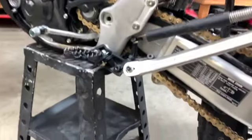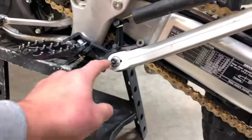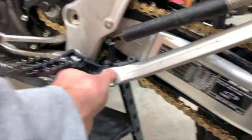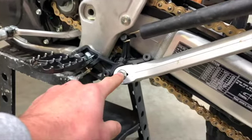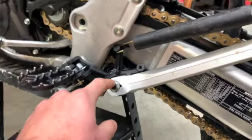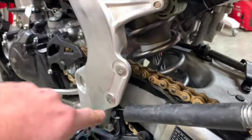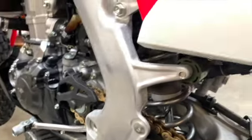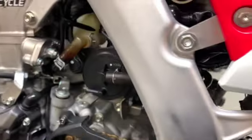I did this real quick while my phone was charging — eliminated the kickstand sensor. The mechanism is here. I took the two bolts of the guard off. I actually used one of the short bolts and just put it in here so it looks cleaner. It runs up to a bracket here. I ground the two tabs off on the bracket so it's just a little bit cleaner. Put the bolts back in, then unbolted on the back side of the frame — there's another bracket there, eight millimeter unbolted. And put the bypass in — it's right up in there, kind of hard to see.